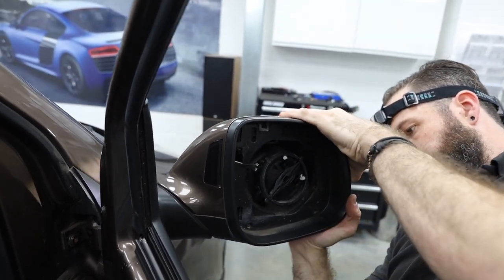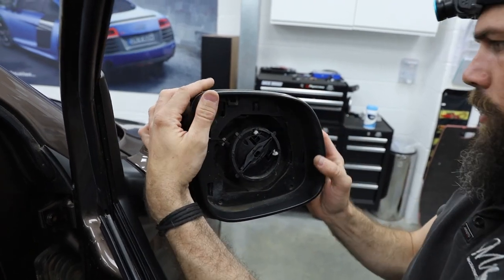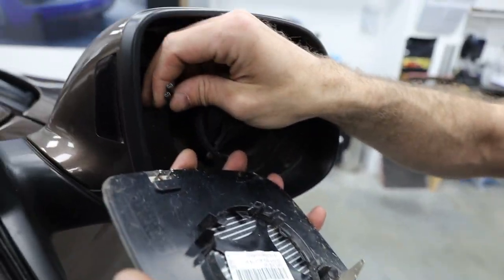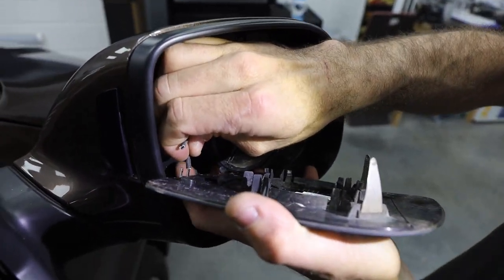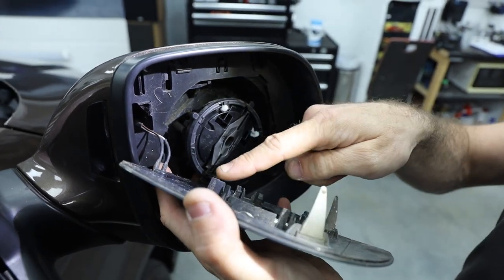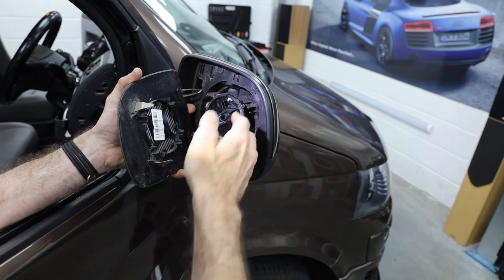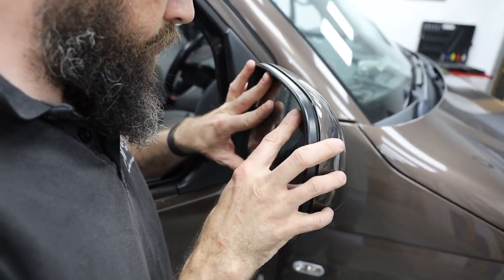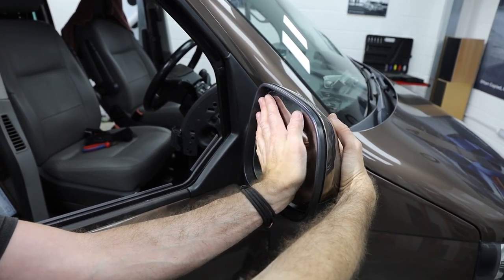You'll feel the wing mirror case is secure irrespective of whether you've broken a clip — don't panic, the mirror cap will still secure on. Step 27: replace the mirror glass. There's no polarity here — it doesn't matter which way you put it, it will still make a circuit. Push those in all the way home using the actual base itself. You can't really go wrong as long as it's central. Place it on, self-locate, and with your whole palm over the mirror push home with a little wiggle to make sure the glass has located properly.